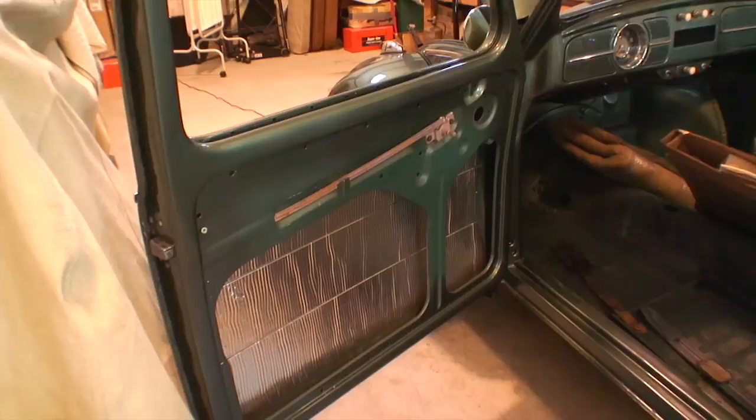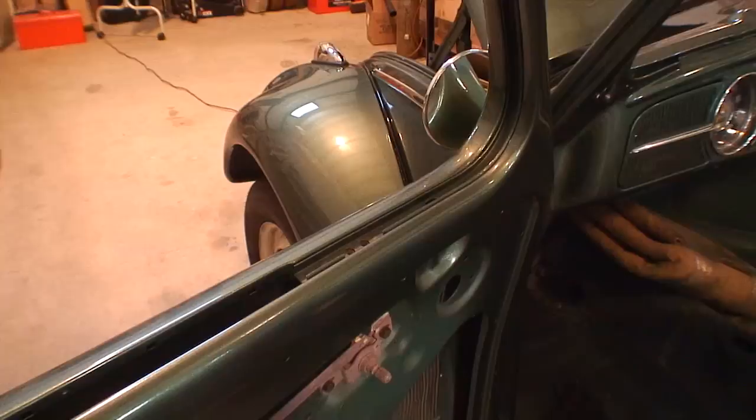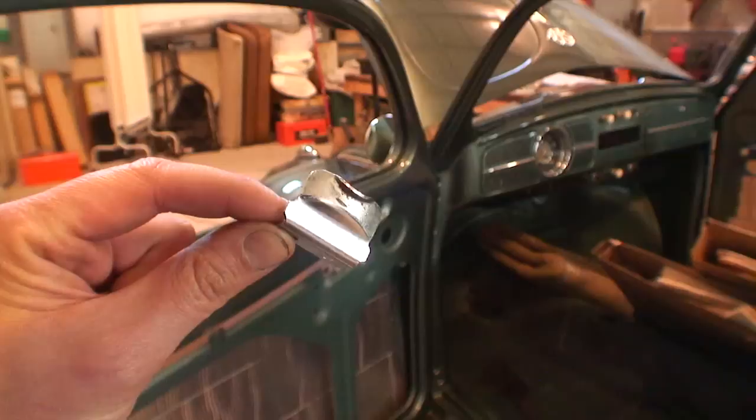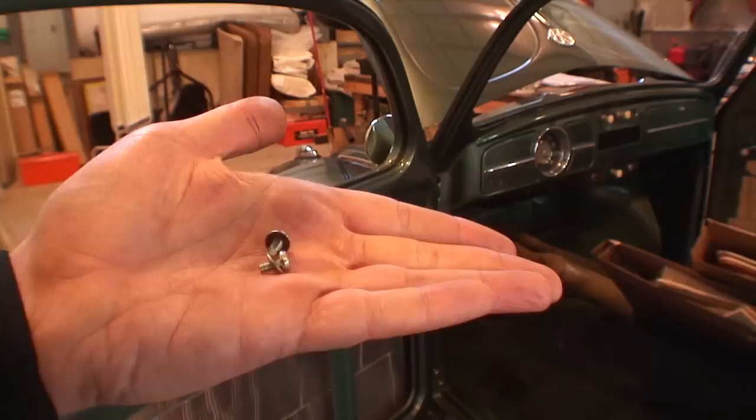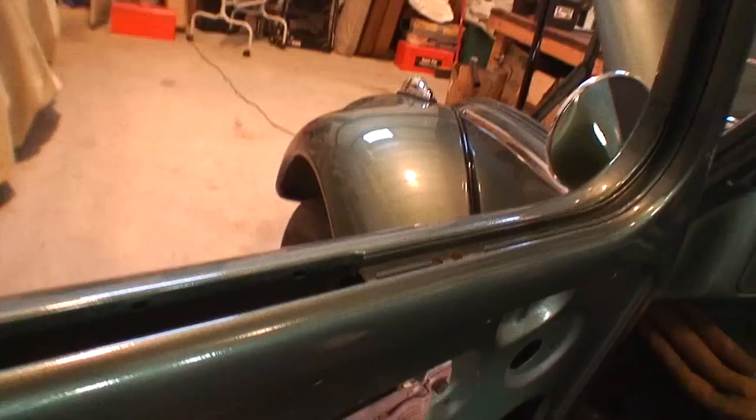Here's the driver's door. As you can see, it's pretty gutted. We gut our cars before we send out for paint, so it's a lot easier for the painter. Sometimes these holes where the two little screws go that hold the little catch down — sometimes they rot out too. They're very tough to get out, so you have to drill them out. Then you might have to tap new threads. As you can see here, I bought new screws. The threads in that door were good. I just went to the hardware store, took out the old ones and brought them in, and matched them up to get some new ones.